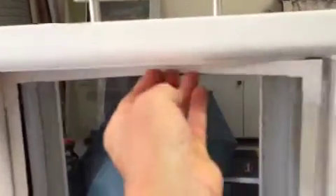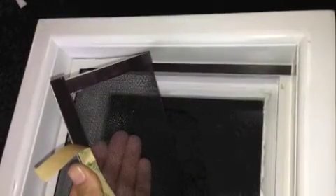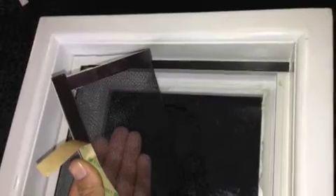Position the screen now precisely on the magnets. Peel out the top right corner and start removing the backing tape, while gently pushing the screen taut as you apply the adhesive.